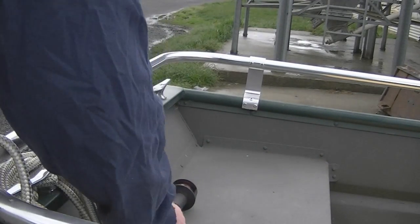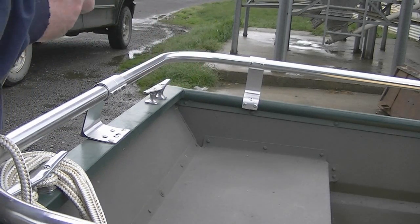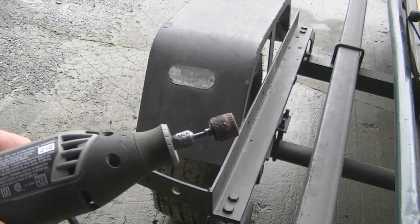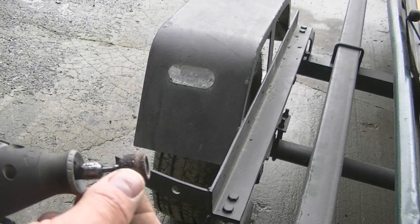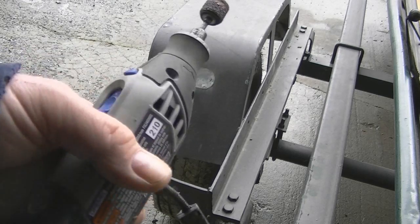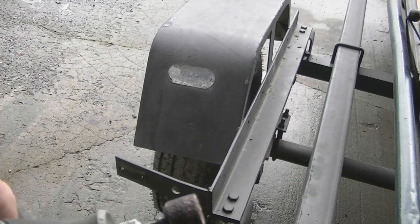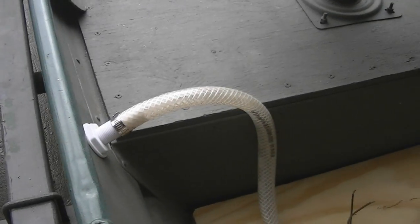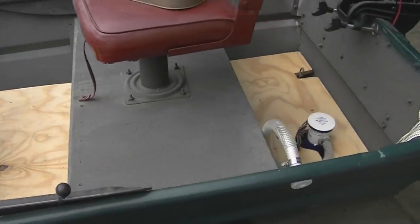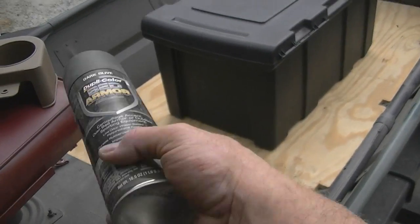On the front light, we're going to use these two pieces of aluminum, take it out of this mount, cut it, and make a little channel — that's where we're going to put the light. The attachment I used on the Dremel is just a little sanding wheel that slides down over the rubber piece. With a variable speed Dremel, if you start out slow you can just start grinding a little bit at a time. We're going to take the plywood and coat it front and back with Dupli-Color bed armor, like I've done the inside.